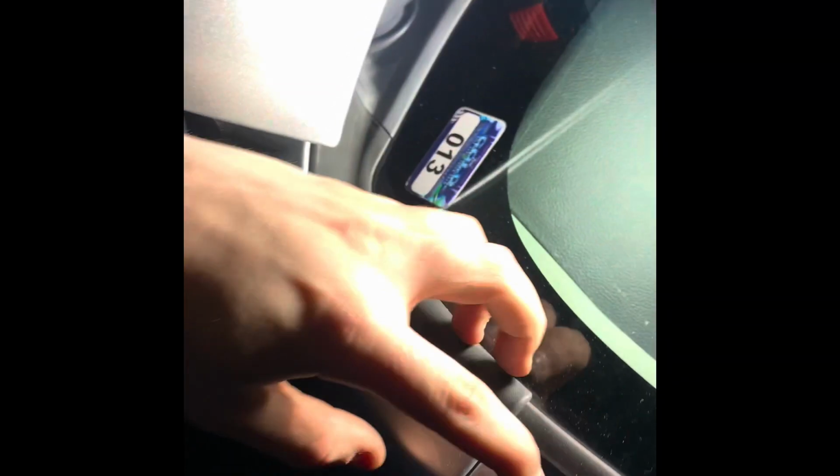All right, now for this side, what you're gonna do is just pull back on this. Then you're gonna expose that bolt. That's also a 10mm bolt. And then, all right, so we've come into another problem. There's two zip ties that hold this wire harness onto the side fender. So yeah, we gotta figure out a place to put that so that the wires aren't dangling, obviously.